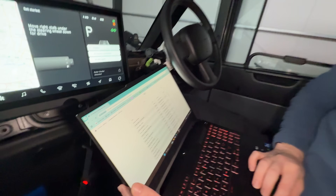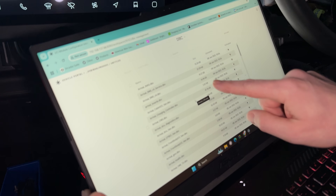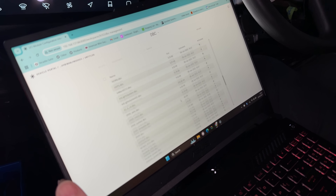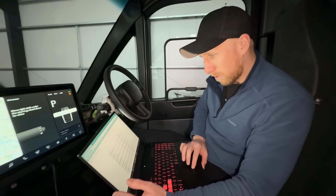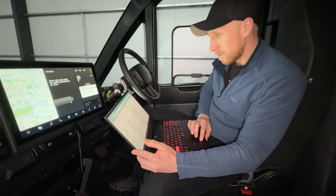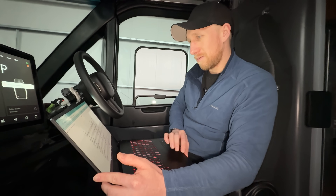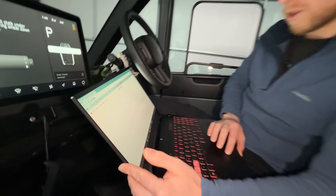DBCs — this is clever. It looks like in here it has every single DBC file stored, which is all the CAN data for every module already loaded onto this thing. Even for the heat pump — everything's on here, which is some really useful information. I don't know if it will let me download the DBC files. No — you can upload, you can delete, deactivate, upload, but it won't let me download them, which would have been great. And there's another one here which is control board, which has no data in it at all.